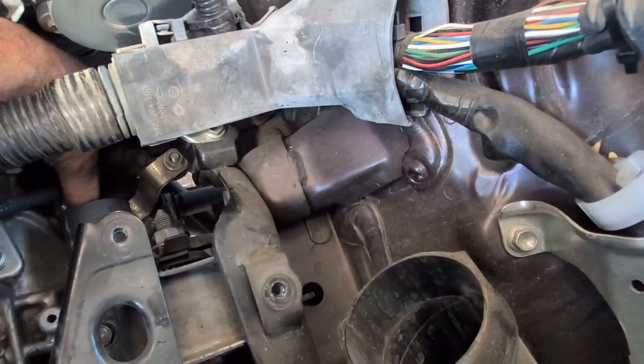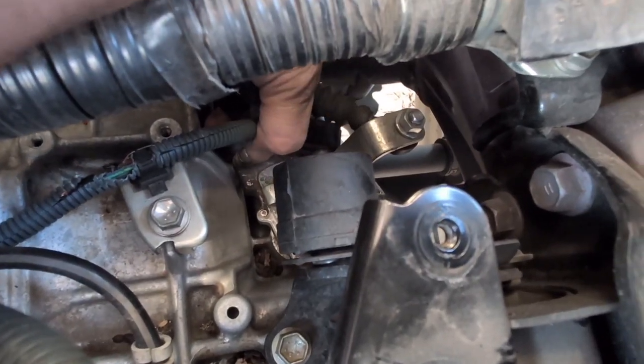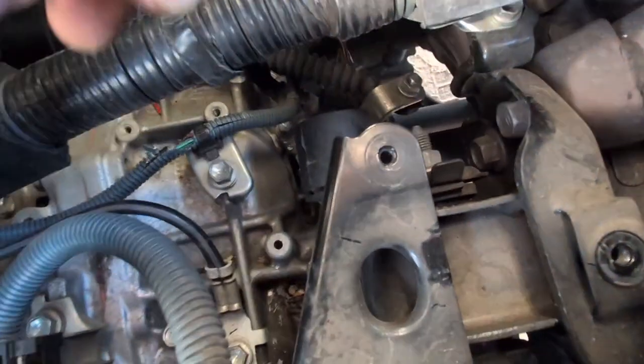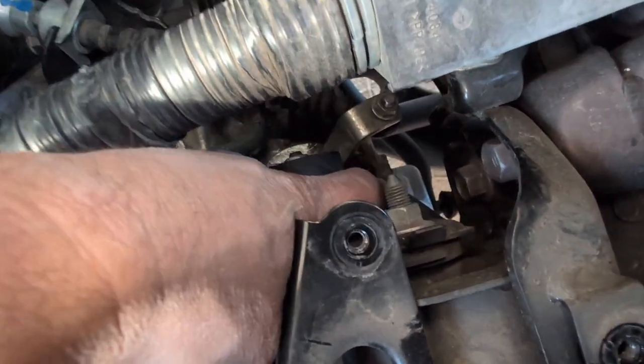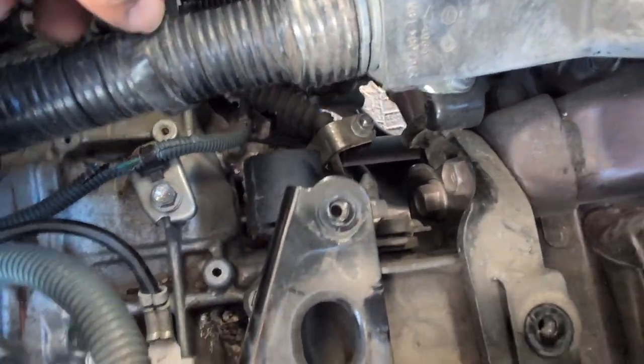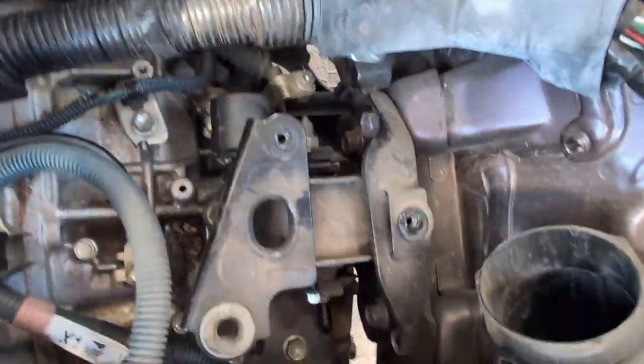It's gonna be hard to see because the bolts are in there. We gotta take that 10 out there where my thumb is, and then on the other side, down right here, there's another one, which is easy to get to. I know it's hard to see, but we need to take those 10s out and pull out the neutral safety switch and see how hard that is.